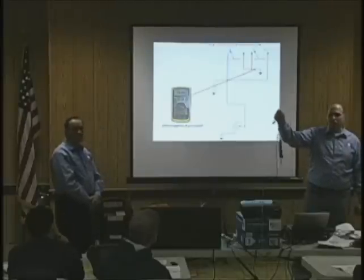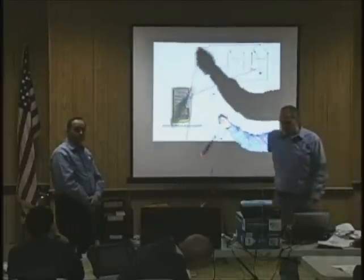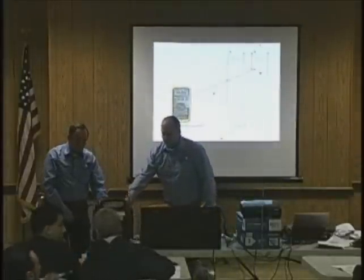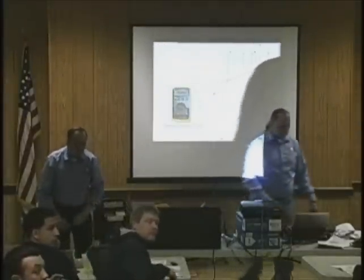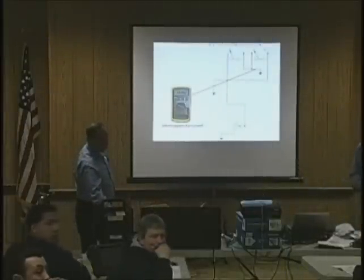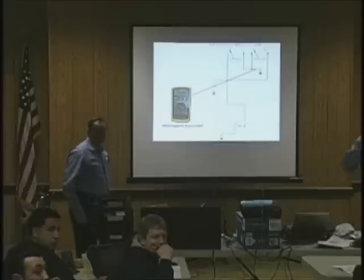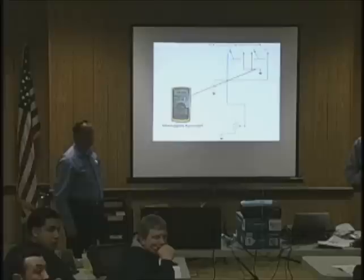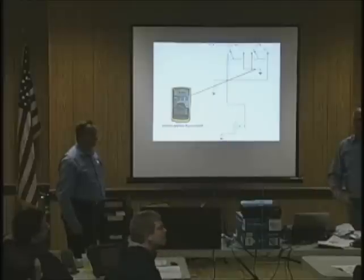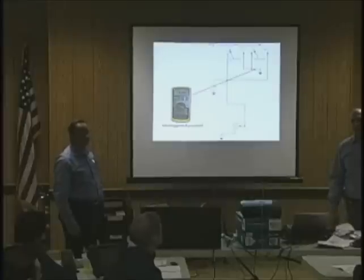Any questions? Comment, Pierre. Yeah, you know, I don't know if all of you guys know what he means by a ground strap. Radio Shack has them. It's usually a Velcro wrist strap or ankle strap that has a wire on it with an alligator clip, and you connect it to a good ground, so when you touch something, you are grounded and you don't have a different electrical potential, so you don't give it that static discharge, that shock. And by the way, anyone who works on computer stuff either has ground mats or wears these things every time they touch something. They're cheap, by the way.